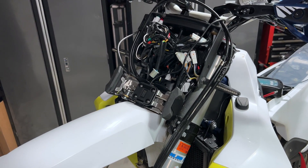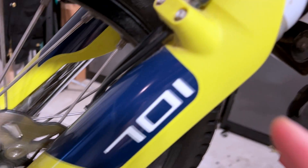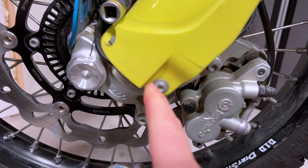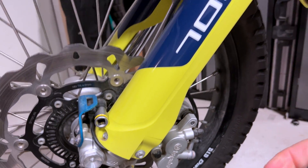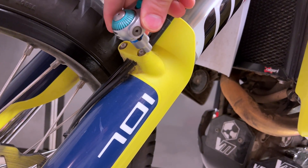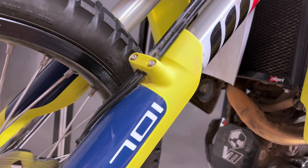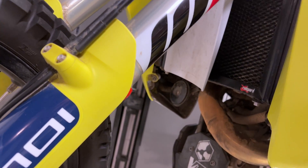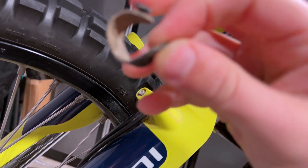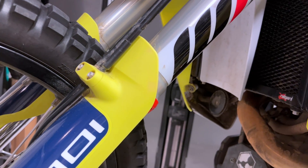Once you trace the cable it's pretty simple. Size 10 here and size 7 to get that off, also a size 10 here. You don't need to remove those — you just need to get this piece off right here that is holding these two to the fork guard. There was also a little rubber clasp thing right here — it was easy to remove, but they are breakable. If it breaks, just put a zip tie on it — no big deal.